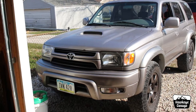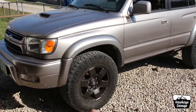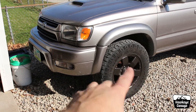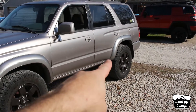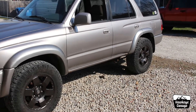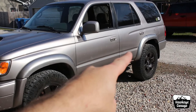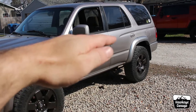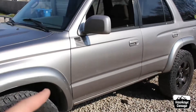Running awesome, still a little bit noisy, but whatever. Currently I have no sway bars, because the front one's end links were completely rusted out and the body mount bushings are seized and rotten. But I have new parts for that coming, so I will be getting a brand new front sway bar. New stock springs in the back — just picked up a set of OE-style Moog springs off Amazon, because there was literally like an inch between the bump stop and the axle, so needed some springs. Picked up about an inch or so of lift. It needs new rear shocks too because it's a little bouncy, so we'll get some new shocks and probably put some new struts on the front.